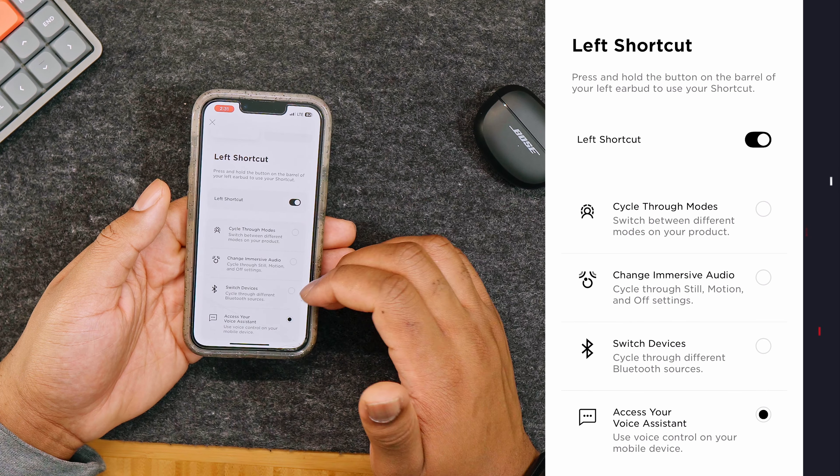When creating a mode, you'll have the ability to try a demo and then confirm. You can also set a shortcut to use voice settings hands-free — go to shortcuts, choose your preferred voice assistant, and then whenever you're ready just press the button and speak your request. The mic should pick it up. To end voice control, just press the same button again.